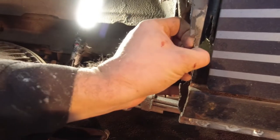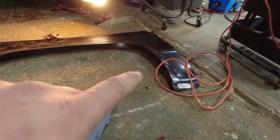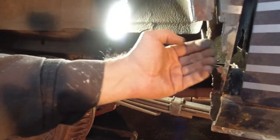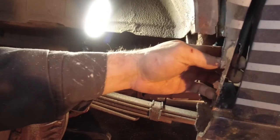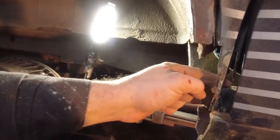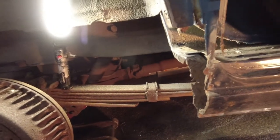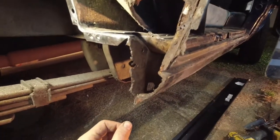and that'll be that piece, which when I do the outer skin, when I do that corner there, I'm going to cut that at the same place, and then I'm going to bend that piece out and weld them together there, and then that'll join that. And then I've got a couple more small 90 degrees in here. But again, the same thing, I've got a top and a bottom, so all I have to do is make these pieces go from the top to the bottom of the spaces where they're supposed to be. So this is all going to be fiddly and annoying, but not actually hard.